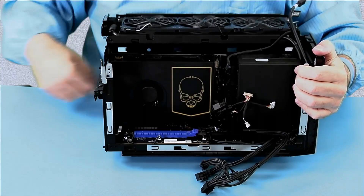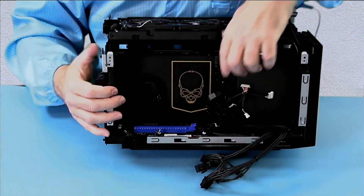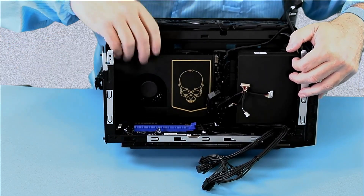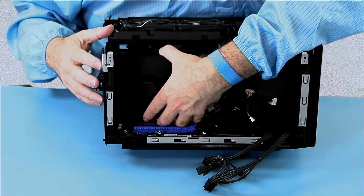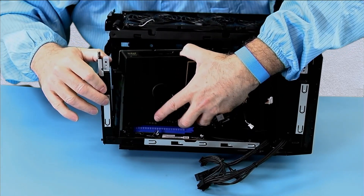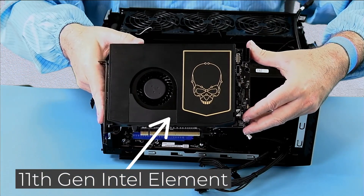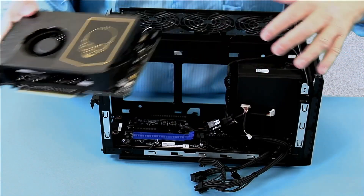At this point I've gone to the back and ejected. All of these big slots have little locking tabs and they need to be up to eject — so on the back I've ejected it. I've taken the screw out, taken all the cables out, and I just need to get out of my way. I'm going to slide the card up out of the slot and then swing it gently out. And there is my element card. It is a beast to try to get out if you don't know how. The only cable left is the blower.